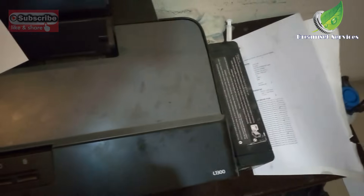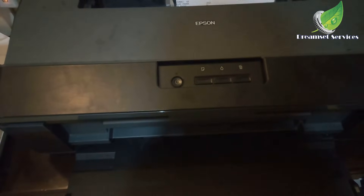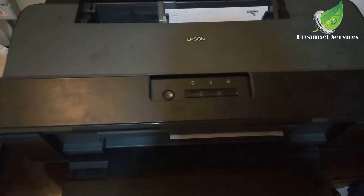You keep spinning until the two white prongs become visible. When the two white plastic prongs are visible, you know that it is set correctly. Then redo it again — hopefully the problem is solved. I've been able to reset it right now. I'll put another piece of paper and let's see if the problem is solved. The paper is preparing to print — hopefully it's going to print out normally.